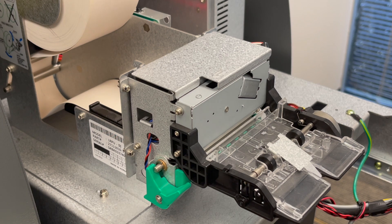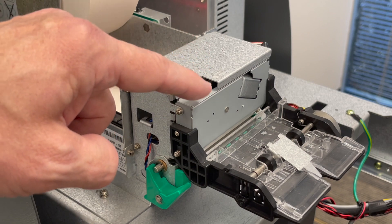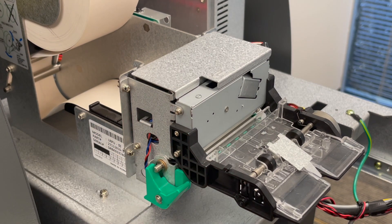When this happens, there are two things you can do. The easiest is to turn power off to the machine — in this case I'm turning off the red power button, waiting a moment, and then turning the machine back on. You heard that noise from the front of the printer — that was the cutter returning itself to the home position. Now the lever opens and closes without a problem.